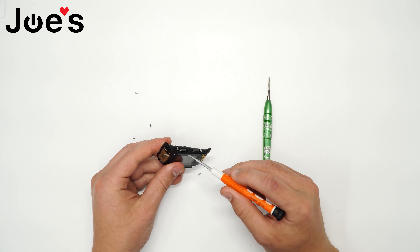There are going to be two ribbons here. You want to pry off the ribbon that's covering the battery, which is the bigger one, first — because it's sitting over top of the smaller one. Next, go ahead and take this smaller one off very carefully.